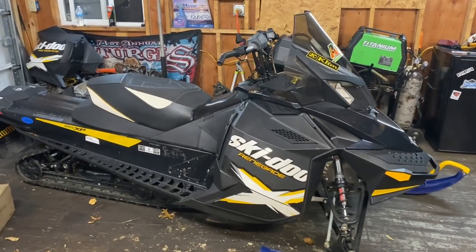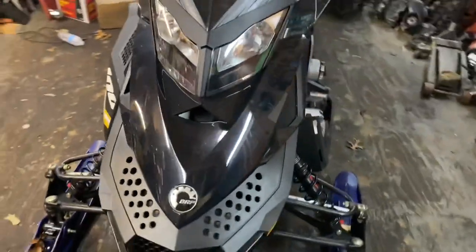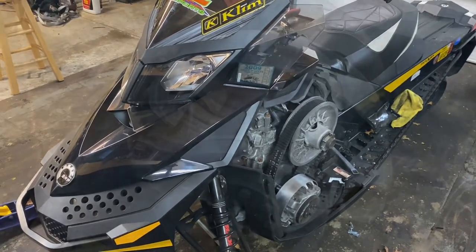Apparently everyone treats crank bearings like cam bearings and just decides to not look at them. And I'm guilty of it too, but it's a service item you should totally handle. And I'm going to go through how to do PTO side crank bearing grease today.